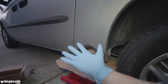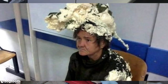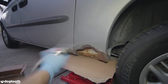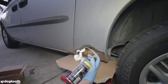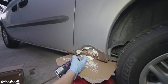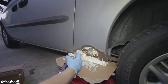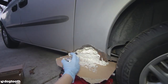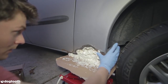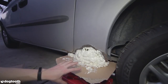Please wear gloves because this stuff will get everywhere. Shake the can well — and refer to the directions on the bottle. Mine says the foam is tack-free in 15 minutes and will cure in 8 hours, so I will let it sit overnight and come back tomorrow.